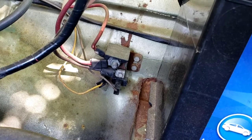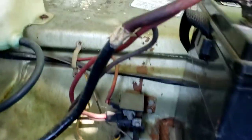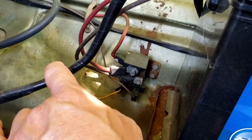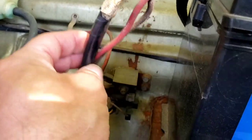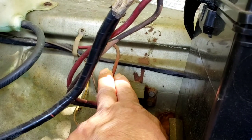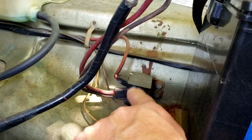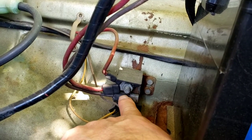Going through it quickly: you've got your regular ground cable, which attaches to the engine or chassis. Over here is your positive cable — one cable goes to the starter, and the other, which is this red one right here, is the secondary cable that goes to the top terminal on the relay. On that top terminal there's another red wire, which goes inside to power your radio, headlights, and everything else.